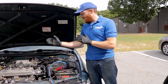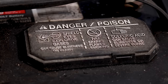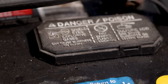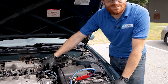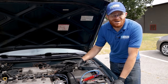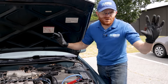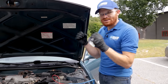The reason I ground to the engine rather than the terminal is a couple of things. As you can read right on the battery, it contains sulfuric acid, and there could be explosive gases lingering around the vent area. If I make a connection there and it arcs or sparks, that's no good. By connecting to the ground on the engine, you ensure a proper ground between your engine and battery. If it doesn't start, that tells you there's a grounding issue. It also creates a fused circuit so you don't cause damage to either vehicle's computers. And if the battery is shorted out internally, you won't have something exploding in your face.